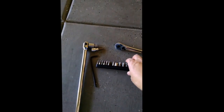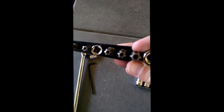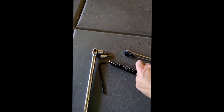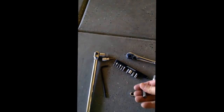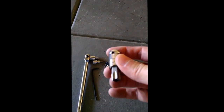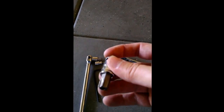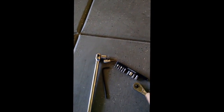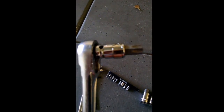The fill plug uses a star-shaped tool called a Torx. This comes as a set with a socket adapter — you put the Torx bit into the socket and attach it to your ratchet or breaker bar. There's not a lot of room under there; a radiator hose is kind of in your way, but with just a little bit of pressure against the hose you should be able to get it attached to your ratchet and loosen the fill plug.